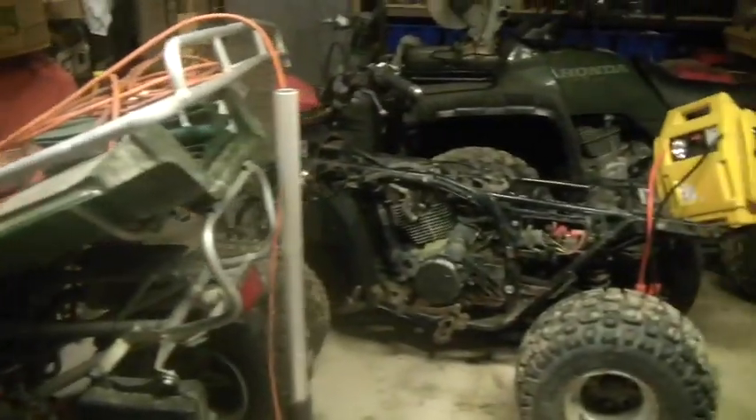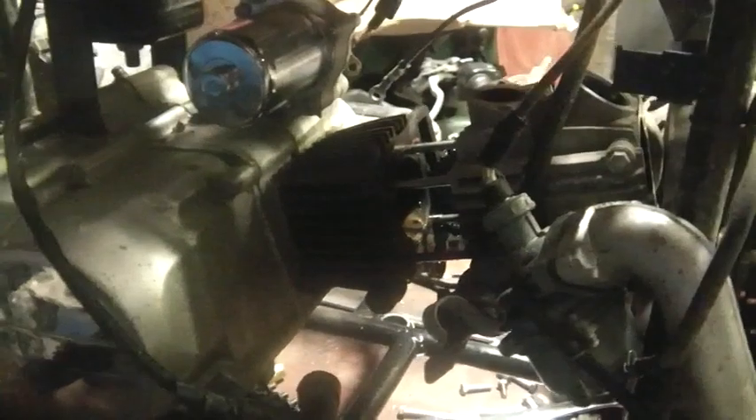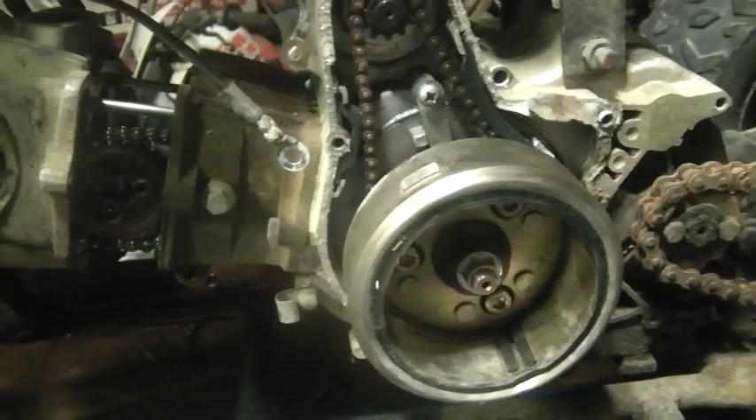If you go and watch Jeff Two Jeff One — it's literally J-E-F-F, the number one — he put a 48-volt electric motor in a '48 Cushman and he's got that thing doing wheelies and donuts and all kinds of crazy stuff. Anyway, this is a relatively short video. This is 70cc, which is a correction — I think I said it was 90 or 110 before, so that's correction number one. Number two: it's water seized, so I need to get the engine out, finish taking the jug out, clean that up, put it back together again, and see if we can't make this thing go.